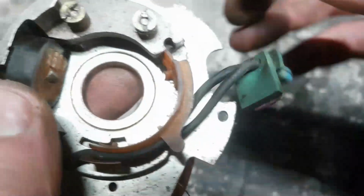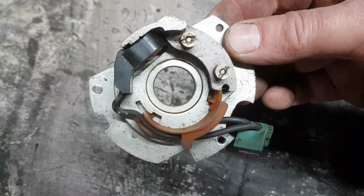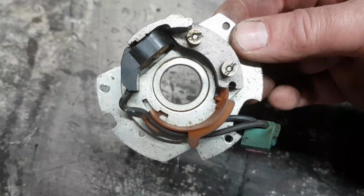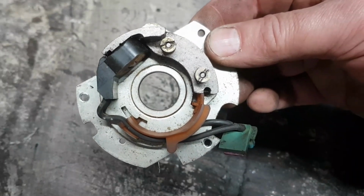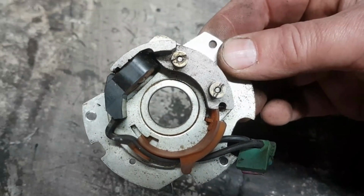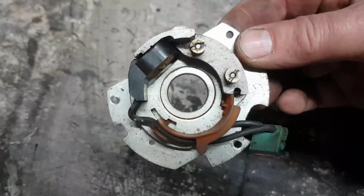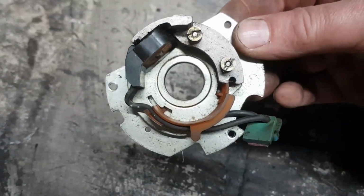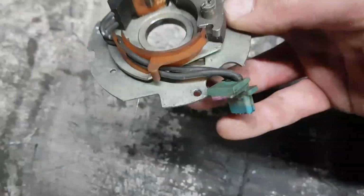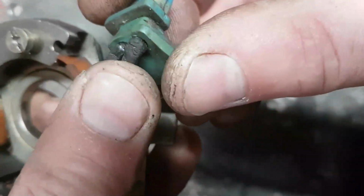So I am almost certain now that this thing was the root cause. The weak spark we had, the non-ignition. It's turning over and has enough of a spark to tell the coil to trigger, i.e. we're getting a spark on each of the 8 cylinders. We're getting a signal back to the ECU to say, yep, the engine's turning, feel free to deliver fuel. And all it was doing was flooding the engine because the spark wasn't strong enough. It was this. Because we've proven all of the other components are in rude health.